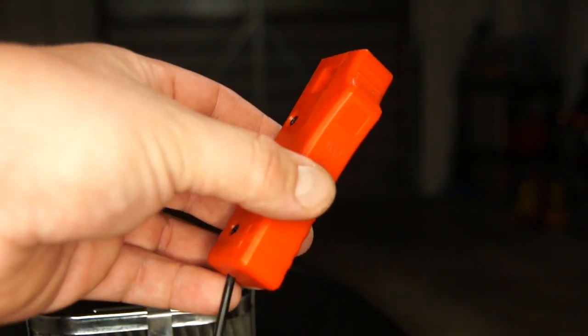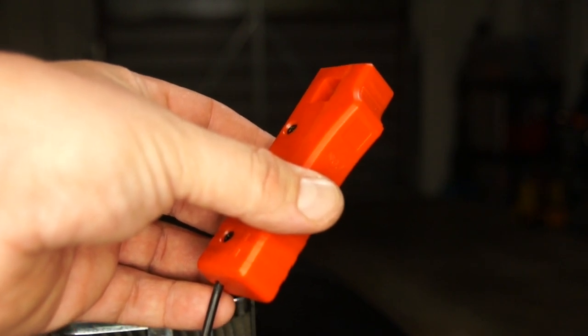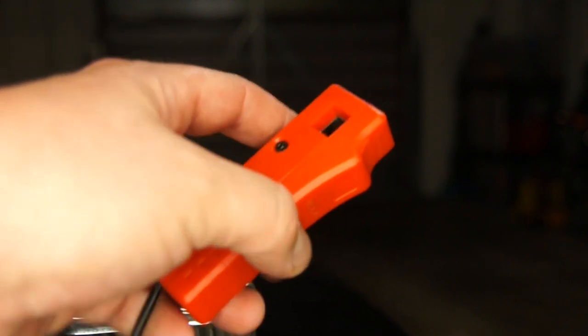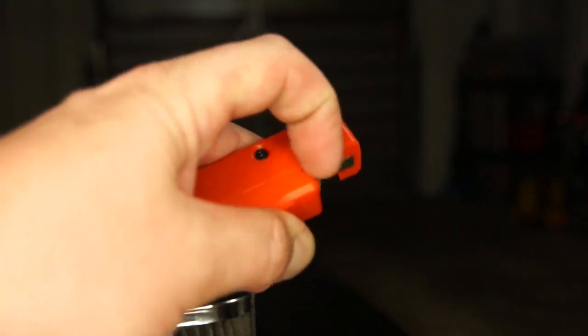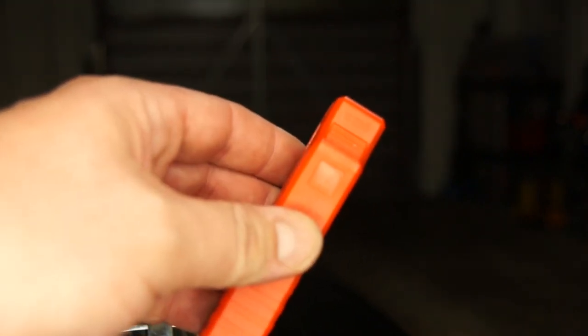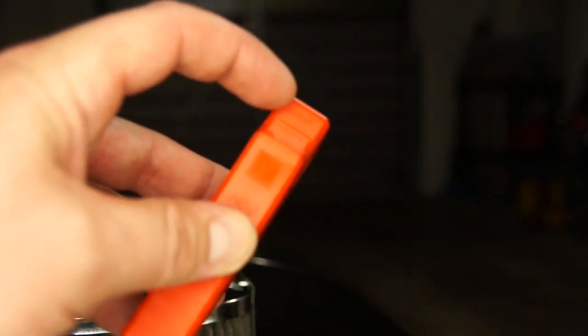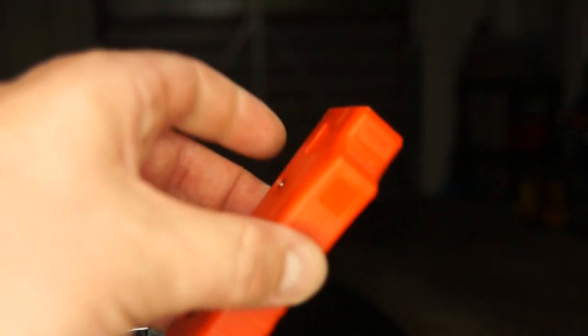So first let's put on the pickup. This always goes on number one cylinder's HT lead. You slide this back here, put the spark plug lead through and slide it shut. It's important to note that there's always an arrow on it, and this arrow indicates the spark's direction. So this arrow needs to essentially point towards the head and not towards the distributor.